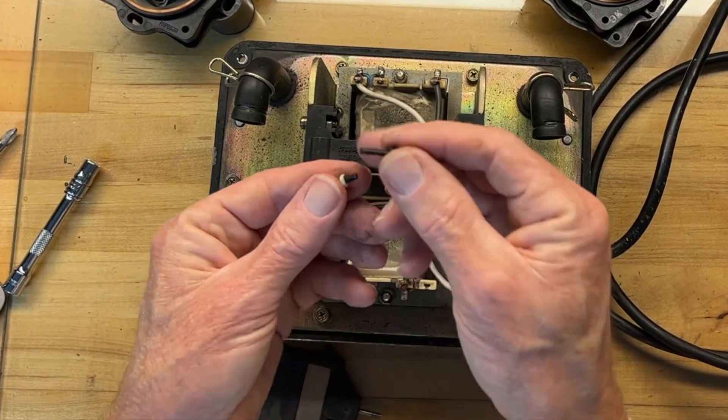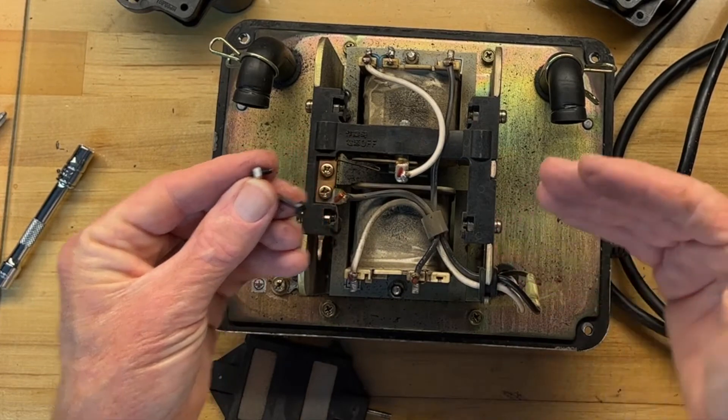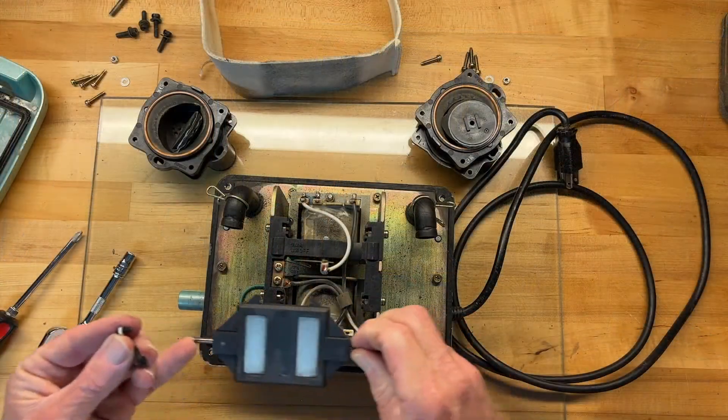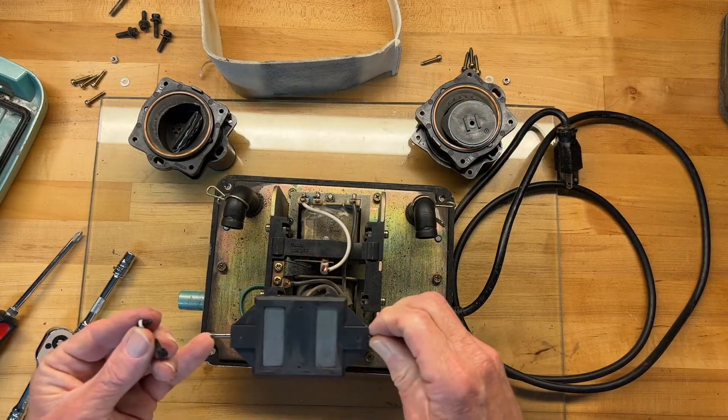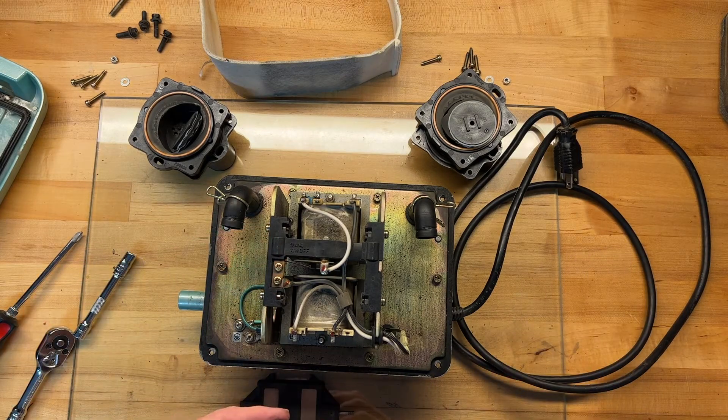This little sacrificial screw acts like a mechanical fuse. When the shuttle is moving too far because a diaphragm broke, it hits this screw, breaks it, and that shuts the unit off. That's usually when your alarm will go off and tell you the pump's not working.